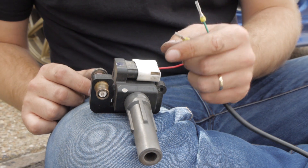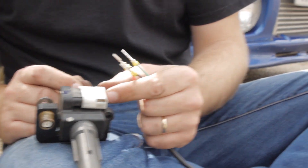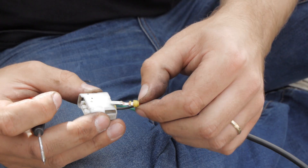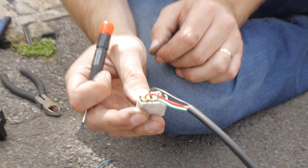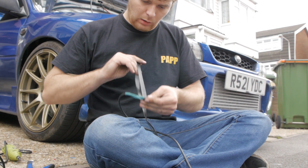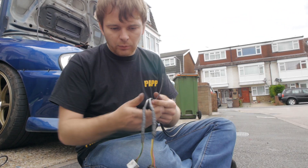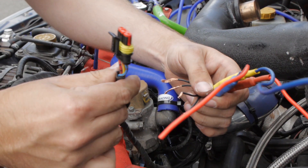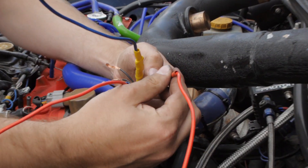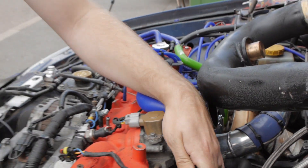Number one, which is this one, is your signal — so that's going to be our green. The middle one, number two, is going to be the ground. And the third one is the constant 12 volts power. We're wrapping our wiring loom with insulation for some extra protection — it's like a condom for your loom. You have to share all these cables into three plugs. We've got the yellow which is the power pin — going to be front and rear sparks — then joining everything out to the ground. That's going to be my wiring loom, nice and thick all of a sudden.